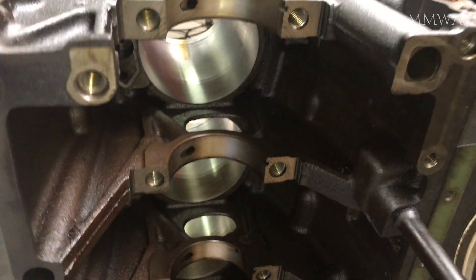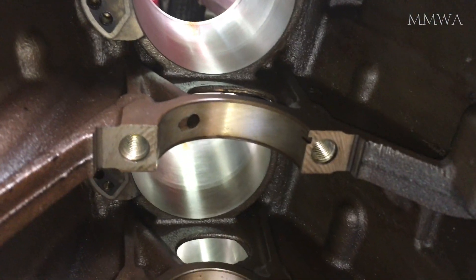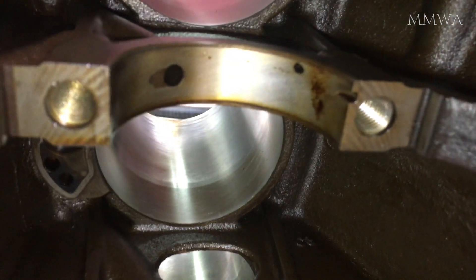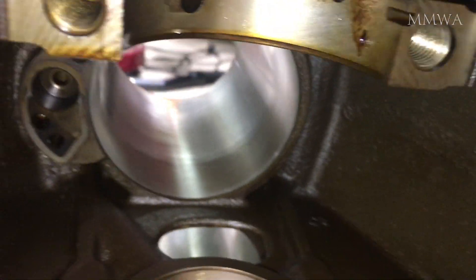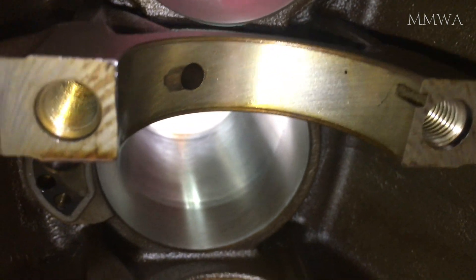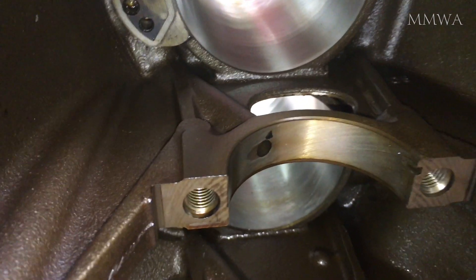Here's just a quick view from the rear side. As you can see on the left hand side, those drillings are for the piston cooling oil squirters. I did remove those already. I just have to make sure my new pistons will clear those, but the machine shop will take care of that if they don't.